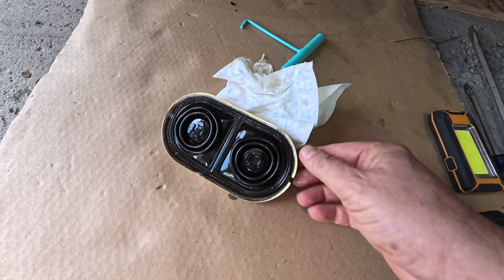I'm going to add more fluid to the master cylinder itself — I want to make sure it doesn't empty out. I'm done. Look at that dirt in there. Glad I did it. Now I don't have to do it for three or four more years. Look at how clean that fluid is now. I used a little bit more than 32 ounces — normally 32 ounces is all you need. My old fluid was extra dirty, and I wanted to make sure. Having the right tools really helps out.